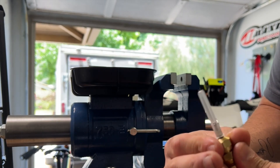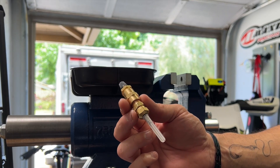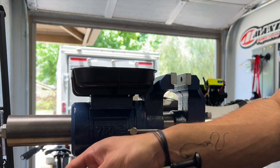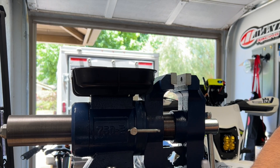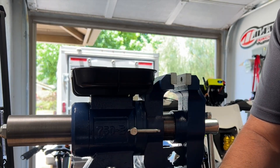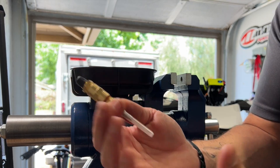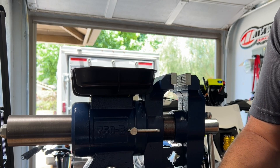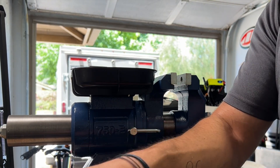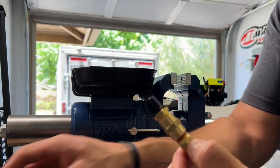Place the needle back on and tighten it up and you are good to go. Now you're ready to do some shocks — you can do forks on the motorcycle or mountain bike forks. You can use a small pump like this; motorcycle forks are not that high pressure. Always stabilize the needle — you don't want a piece of needle broken off down in the bladder. Remove the needle for storage, throw it in the toolbox. If you want to add some bling, Tusk makes cool inexpensive aluminum caps to make everything look more pro.